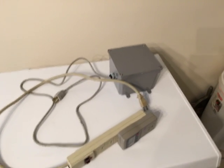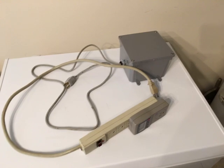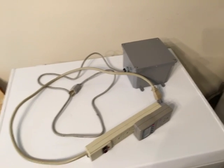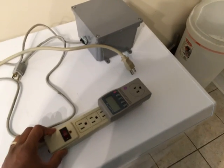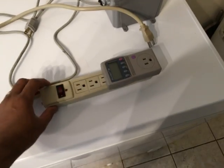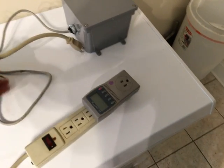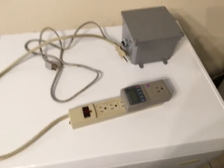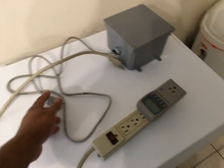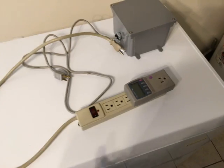A true community operates with respect. At first during our conversation I was like, 'well, it may be working,' but while we were on the phone he was explaining how it actually works. He gave me some ideas — he said 'check this' — and I pulled out the old Kill-A-Watt meter, plugged this particular outlet into it, and checked. The refrigerator compressor was not running; only the fan was on. I had put this device in hoping it would help start the compressor more easily and reduce low-voltage sag in an off-grid situation.